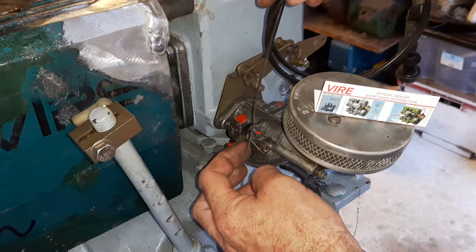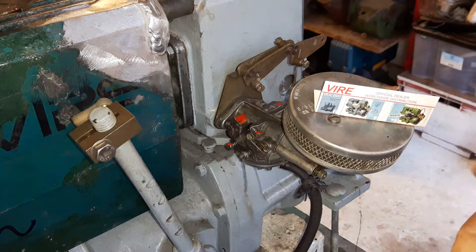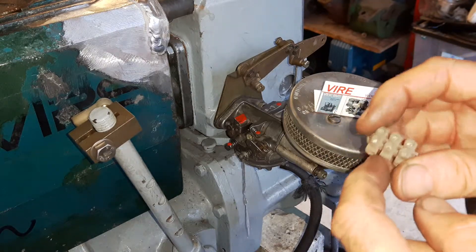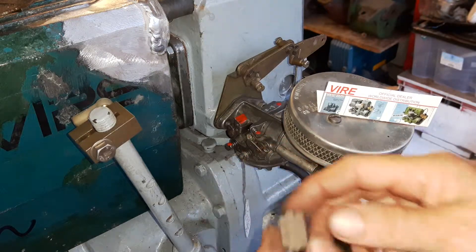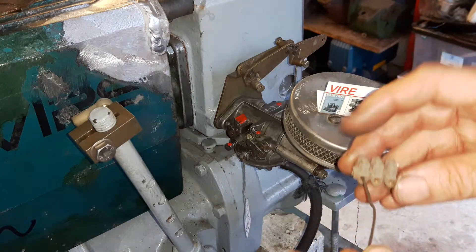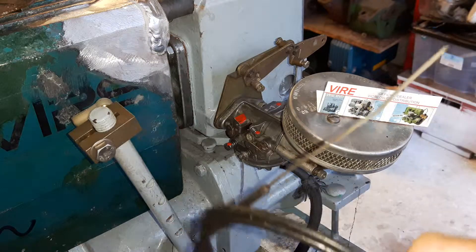In order to attach the stranded cable to the choke lever, you need something that will connect in this little hole. What I suggest: if you get a piece of terminal block, you'll see inside there are brass screws and you can take these out, slide the piece out, and you'll find that the screw, if you take this lever off, can go through. Then you can put your cable inner into the hole and tighten it up while the lever is in position. This is one way of attaching a stranded cable to these old levers.